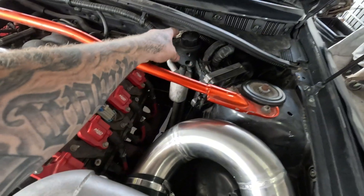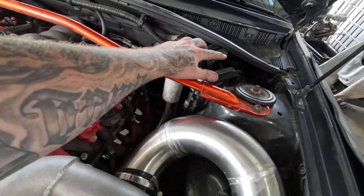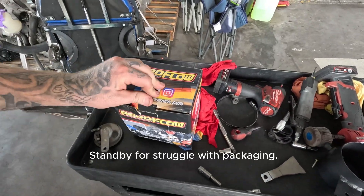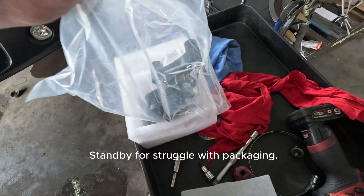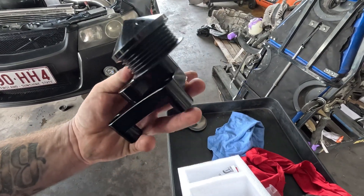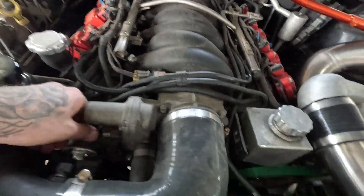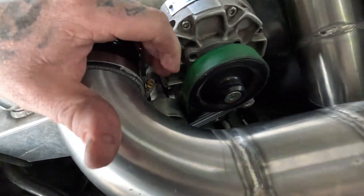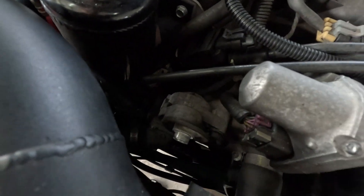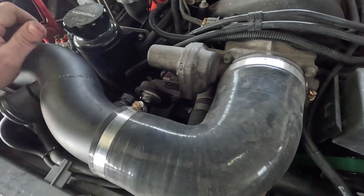The ECU has been moved and mounted back up here. It's like the reservoir that holds the oil for the supercharger - had to move that too. We've got the belt off now and we're going to get this Aeroflow manual tensioner fitted up. One of the reasons it came back is we're having a lot of issues with belt slip, so we've added this idler here to get more purchase on the supercharger pulley. We think just getting rid of the auto tensioner and putting a manual tensioner in there and loading it up a fair bit will sort it out. We'll whack that in.